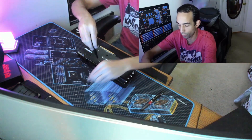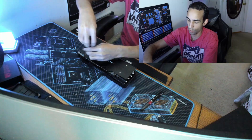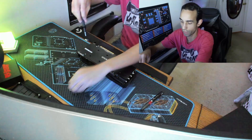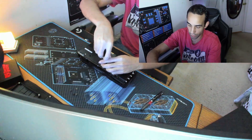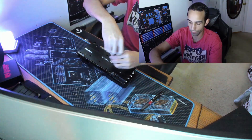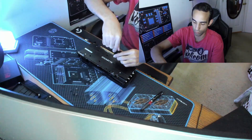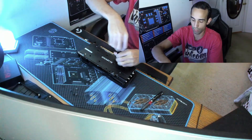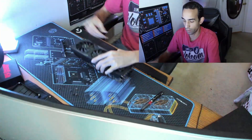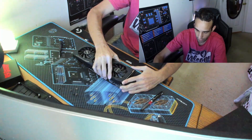This is standard procedure for what I like to do. I even use a toothbrush — if this one had a lot of dust I would use a toothbrush to clean the PCB, because that dust buildup gets pretty bad especially if you're running these GPUs for a long time. The previous owner obviously cleaned it, but why is the back plate getting so warm with no workload on it whatsoever? Also, it randomly disappears from Device Manager. So maybe it's pristine because the previous owner did something to it.